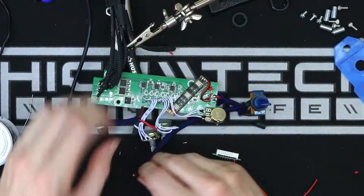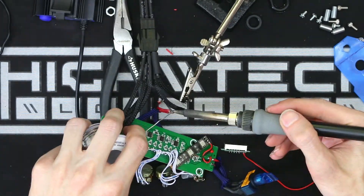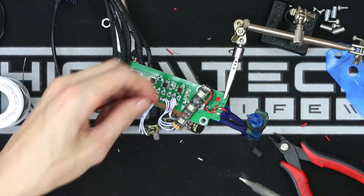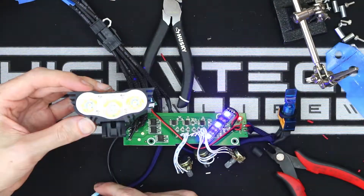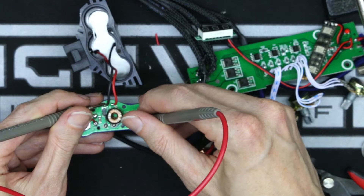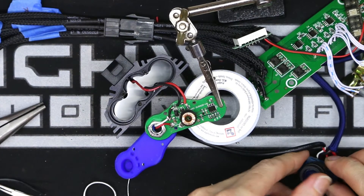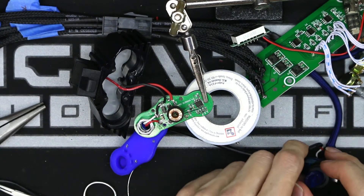Trying to make the wires as clean as possible was by far the most challenging part of this dashboard build, especially the larger power wires. Almost done finally wrapping up the larger power wires that go to the toggle switches. Back to the headlight — what was the issue? The headlight worked fine; it's just that I wanted to add my own toggle power switch to it. This created a problem because it uses a battery and required a soft switch, so just applying power to it with a toggle is not going to turn the light on. I first tried jumping some pins on the timer chip, which in theory should have worked. Then I found a way to just jump it directly — and it actually worked off my toggle — but then it just died and never came back.